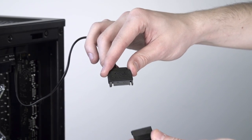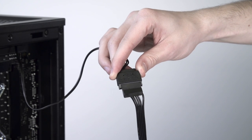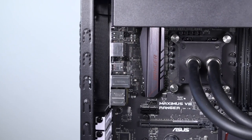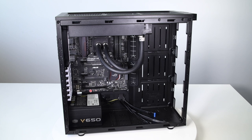Take the power cable from the Predator splitter hub and connect it to the SATA power supply cable. Check with your power supply installation manual for the correct connector. Your Predator installation is now complete. You can proceed to installing other components and connecting the rest of the cables.